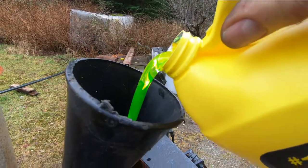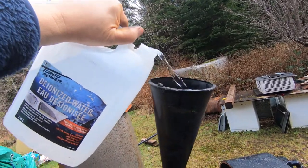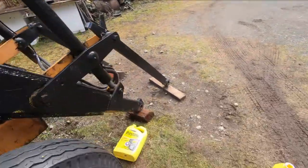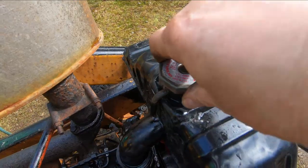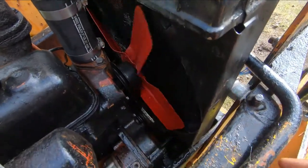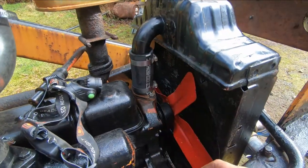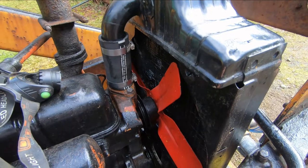Continuing with the 50-50 mix into the rad — that's pretty close to 50-50 — carrying on until I get to the top of the rad. It's now full to the top with a 50-50 mixture of antifreeze and distilled water. We'll put the lid on. We've got new hoses top and bottom, the rad was pressure tested at the shop and had a couple of small leaks fixed. It's all installed and ready for the eventual firing of this tractor. That's all for now — thanks for watching, share, like and subscribe, and we'll see you again soon.